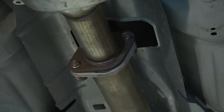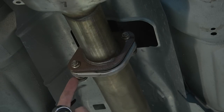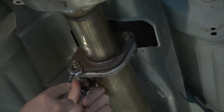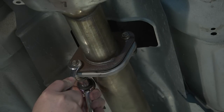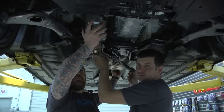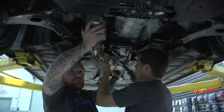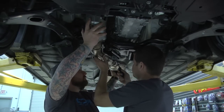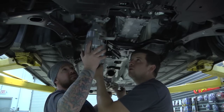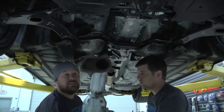The last two bolts to remove are the spring exhaust bolts — 14mm socket and 12mm box wrench. Now the only tricky part to removing the exhaust is this little clip right here. Just grab a little screwdriver and pop it in there to help release it. Then go ahead and pull it off and lower it down slowly so it's out of the way.